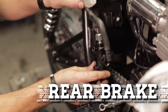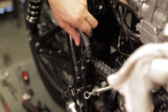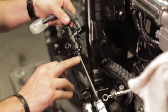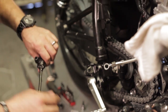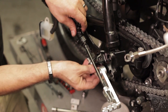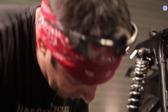So if you remember when we took this apart, it sat up here. This is the master cylinder actuator arm, which was down here — it's not going to work with this type of setup. So we're going to use this, but we're going to change this out. Where this is going to go is back here. It's actually fairly simple to do. We provide this piece with the kit, and as you can see it's much shorter — that's going to butt up right into here. When you pull this rubber piece off, slide that out.